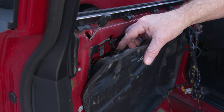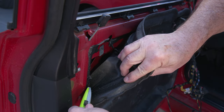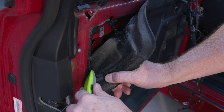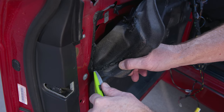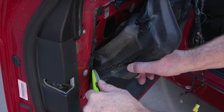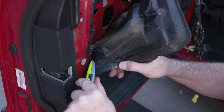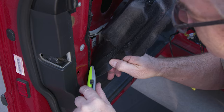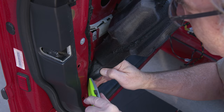The vapor barrier is put on with a real gluey, tarry type of material. If you cut it with a box knife it makes it a little easier, and work your way around gently, trying to get as much of that adhesive off as you can. When you put it back together, if it's still quite stuck it'll re-glue itself. Work real slowly — you don't want to tear up your vapor barrier. As mentioned, it's important to preserve it, and if you can even get the part as a replacement it's going to be quite expensive.